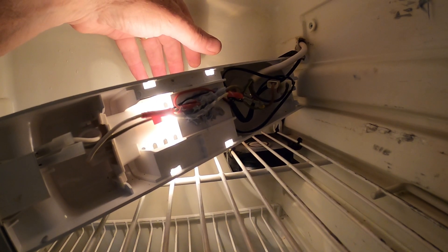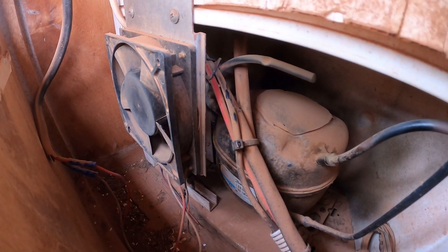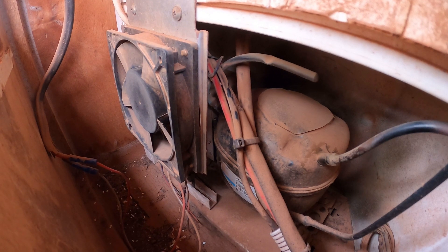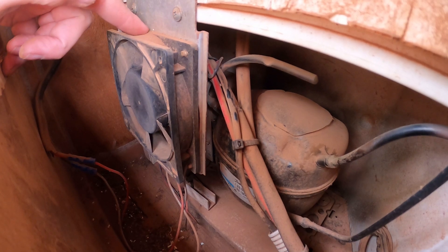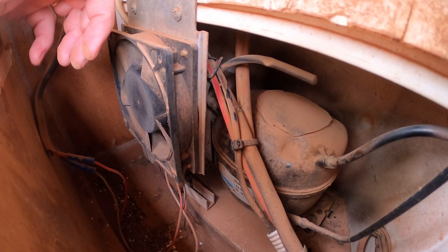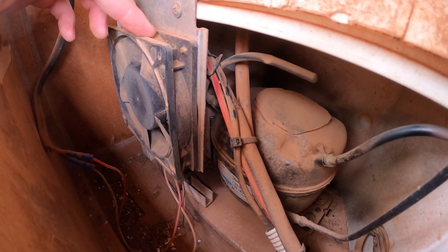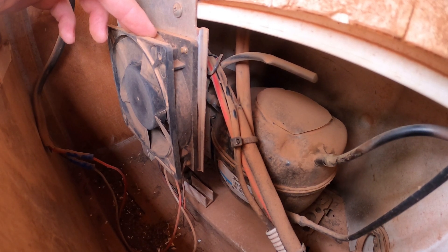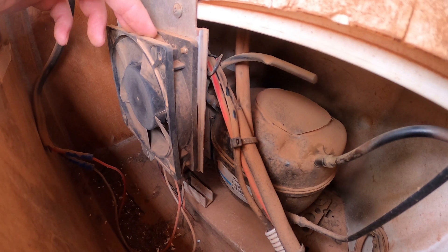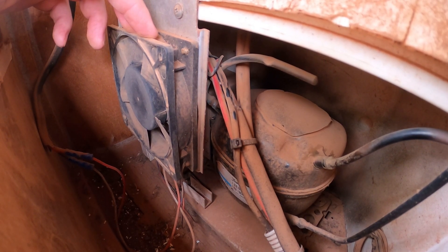This was done back in 2016 and I haven't had to touch it since. The control is mounted up in the cabinetry and the wiring runs down behind the fridge to the compressor. The tricky bit is getting to the wiring at the actual compressor — I had to remove the fan there. Basically you've got to disconnect the original thermostat wiring, then use those two original wires as your temperature probe wiring, and then use the contacts from the electronic thermostat to switch the compressor on and off, connecting to the terminals that originally came from the mechanical thermostat.